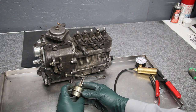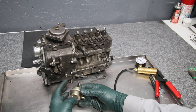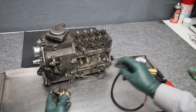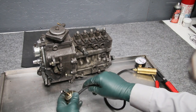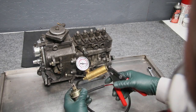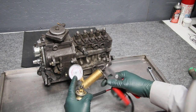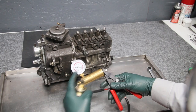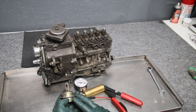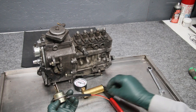If the engine is not quitting quickly — say it's kind of sputtering, muttering, and moaning and finally quits — it could be that this valve is partially working but not fully working. If it's fully working with no vacuum leaks inside, it should pull back all the way and the engine should shut off. Let's put this to the test. To test these, you need a vacuum hand pump tester to apply vacuum. Watch what happens as I try to pump it up — see that? It's leaking. It's not pulling all the way down. This is a classic example of one that may try to shut the engine off, but I cannot get it past about five inches on the vacuum gauge. It pulls down and then leaks back. So this valve was struggling to shut off the engine. If you're having problems with the engine turning off, it could be this valve, but not necessarily — it could be an issue with the vacuum going to the valve.